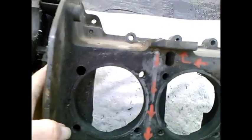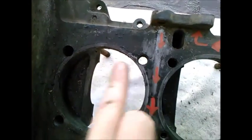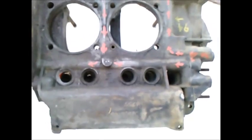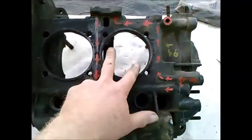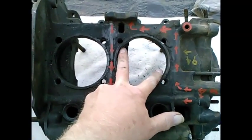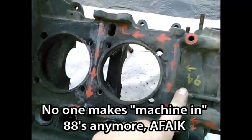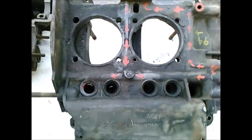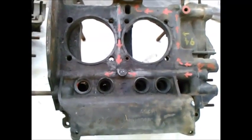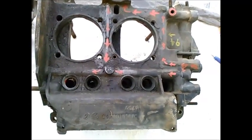The case was deep studded here, I can see. It's also got case savers all around. What else do I need to check? I believe it's been bored out — machine to 88 size. I was thinking of opening it up to 94 and then using those thick wall 92s. But if the case has a fatal flaw, I need to figure that out, perhaps with your help.